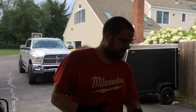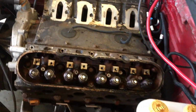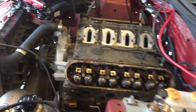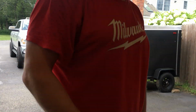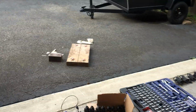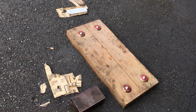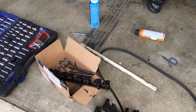Honestly, guys, this is a pretty funny clip of Mark and I just BSing back and forth, but we had the radio on, and I don't want to be copyright striked for the probably $15 I'll make on this video if it gets 15,000 views. But anyway, we're BSing about how much to torque the heads to, and Mark's 1979 Craftsman torque wrench. And like I say, I normally do 65 pounds unless it feels loose. I go to 70 maximum, and Mark was talking about our CNC head decking machine right there, and that's basically it. I start snapping down the head bolts, nice and reused.